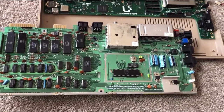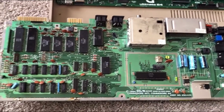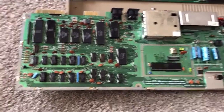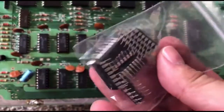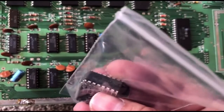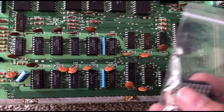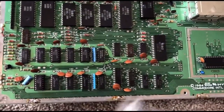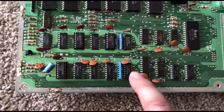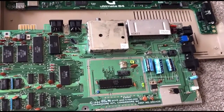This is the Commodore 64 motherboard that I took out of this bread bin donor keyboard. I need to do a RAM fix on here and I've got some chips ready to go in. I can piggyback these and use my test cartridge that I burned to see which RAM chip isn't working and replace them. Right now it's telling me it's one of these down here that's busted.